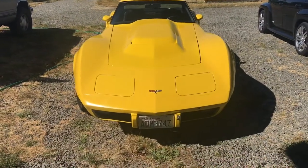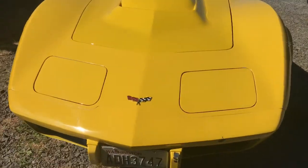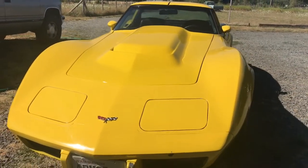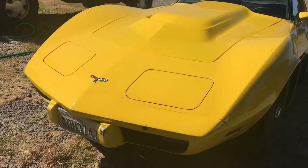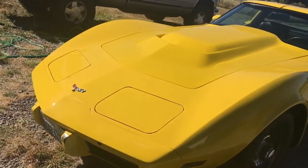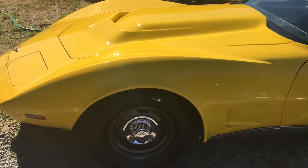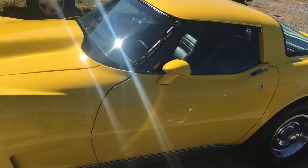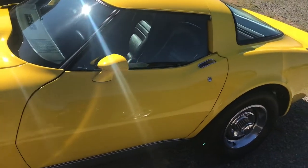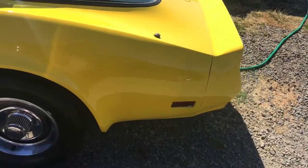There's the 1979 Chevy Corvette walk-around. The car is mechanically sound with everything new mechanically: suspension, brakes, shocks, bushings, control arms, new steering rim, steering box, brand new 454, brand new reverse pattern manual Turbo 400. There's so much new.